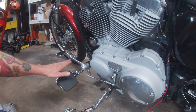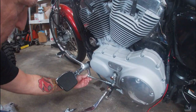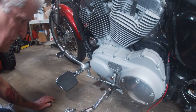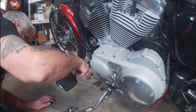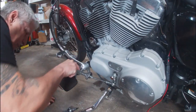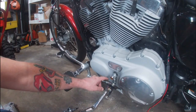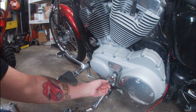So that adjusted the rod — it lifted the shift lever up a little bit more so that everything is where it needs to be. Let's make sure this isn't binding. There — yeah, that's not binding, we're good. Just wanted to make sure the hinge joint wasn't binding. The back one's not binding either, so what I'm going to do is add some blue loctite to this and we'll snug this back down. That should do the trick.